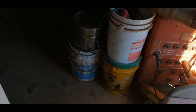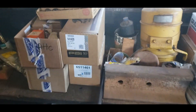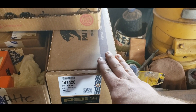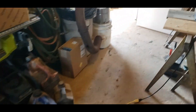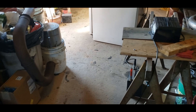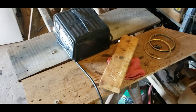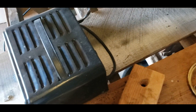Second thing: all of this together — the extra gasket kit plus the PAI oil cooler from AG Kits — with tax and shipping (Kansas sales tax) came to about $340. If you can go to Cummins and get all those parts for $340 or less, I would advise you do that — their gaskets are probably better quality and the cooler probably higher quality. But I honestly don't know what Cummins wants for this stuff. Regardless: do not use the PAI kit.